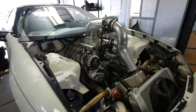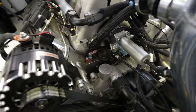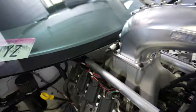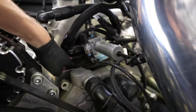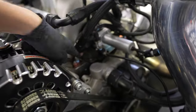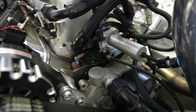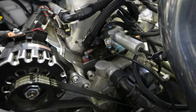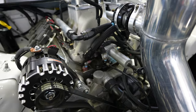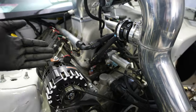Let's get the car down and fix that valley cover leak. If you look closely, it's really dirty under the intake right through here. What it's been doing is actually pushing some fluid back — there's a little bit of standing oil back around the valley cover. I don't think that plate's getting sealed completely. These Allen-type screws are hard to get tight and I stripped one or two already. So what I'm going to do is pull this whole thing apart, actually put proper bolts on it, fix it right, and get this thing sealed up so we quit losing oil out of there.